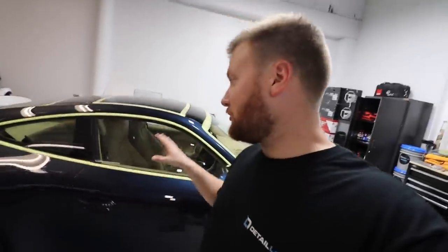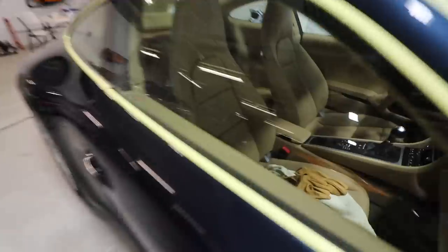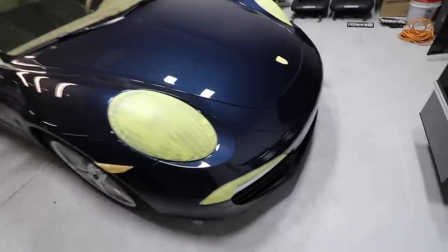That about wraps it up for the polishing on this car. The color came out great — I just have to clean up my mess. The products I used were Jescar correcting compound and Jescar finishing compound — I'll link them in the description below. For the correcting stage I used a Meguiar's microfiber cutting pad, and for the finishing compound to bring that gloss back out I used a foam pad. It's essentially doing the car twice — same kind of process. The car's all done; it's a little dusty, and you can see that in the glass, but we'll get it all blown off and the tape pulled off. Now I need to go through and fill in some of these rock chips.